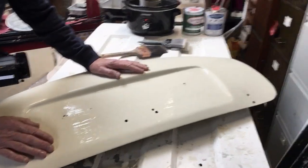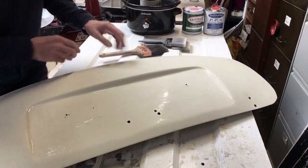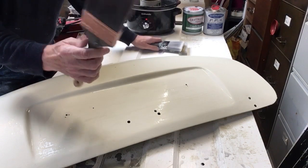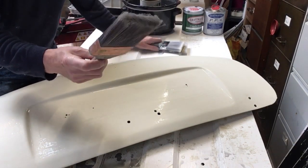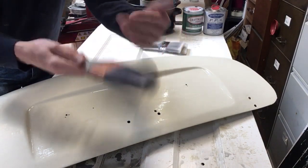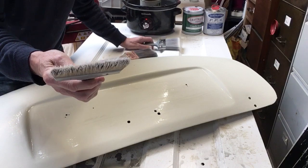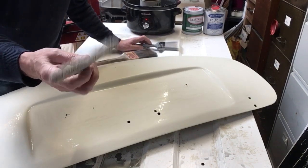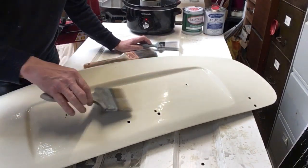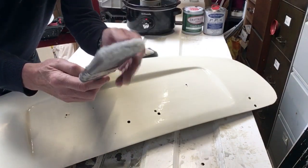I've been asked to demonstrate how to paint after you apply it. This is my normal brush I use for painting the car body panels — it's made by Purdy, a good quality brush, nice and soft but stiff at the same time, more springy. That's a tipping brush: once you've painted it on the big panels, you smooth it off with just the weight of the brush, nice and gently, and it takes all the brush strokes out.